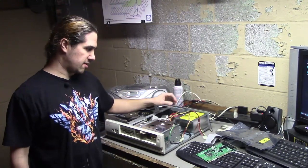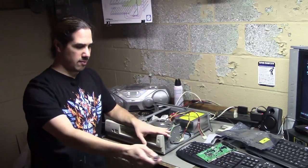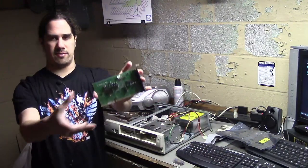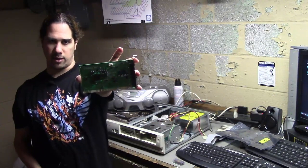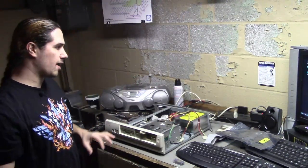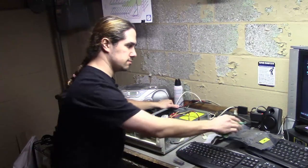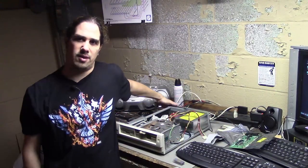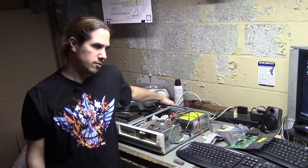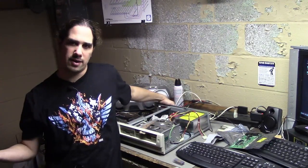I guess that's it for this OfficeMate 286 system. Everything works except the hard drive controller, and adding in any other hard drive controllers just makes it beep. Not sure what else to do with it, but hey, I found this at an estate sale and I'm surprised it even turns on at all. I did buy some upgrades for it — I have a 287XL here and a Vibra 16 sound card, but I'll have to save those for something else or use it with floppy-based drivers. I might close this up and if I think of any way to fix it or boot a hard drive off of it, I'll try later. Anyway, thanks for watching, and if you want to support me on Patreon, link is in the description.